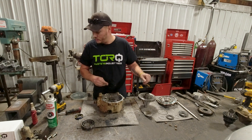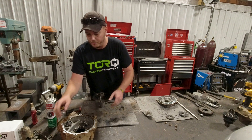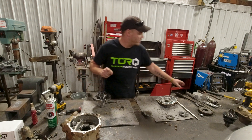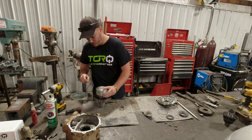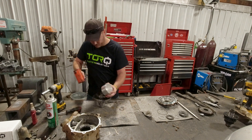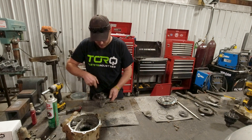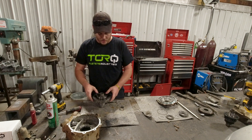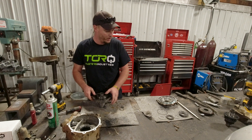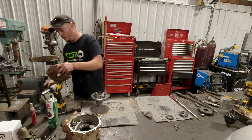These are torqued down. Now we've got to set the bearing back in. I have a driver here because I've done this a bunch of times - it drives the bearing right back down into place until it settles all the way down. You'll hear the tone change. The bearing still spins freely. Now, as I mentioned, you're not going to reuse the tone ring on this side - these new side gears are way bigger than the factory ones so the tone ring will not sit in there.